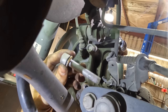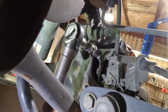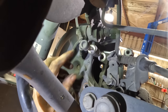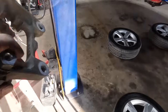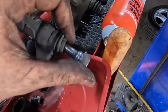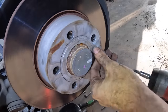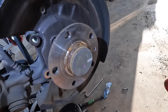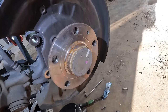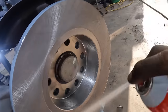It's the bolt that never ends — look at that thing, it's a lot of bolt. Caliper bracket is removed. Let's get out of here, get that bracket out, and pull that rotor off. The set screw is a Torx 30 as well — same as the fronts. The hub is nice and shiny — beautiful. New rotor coming in. Spray it clean, flip it, index it — meaning referencing the set screw hole — and screw it in.